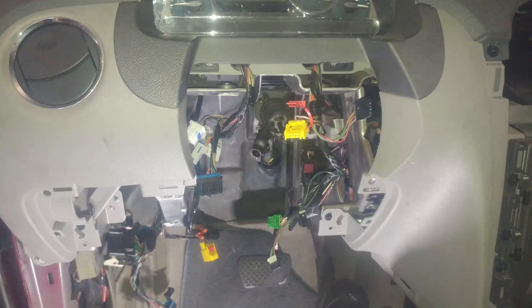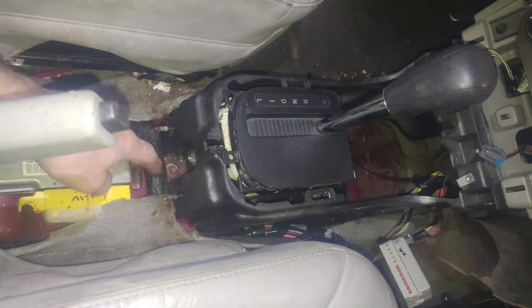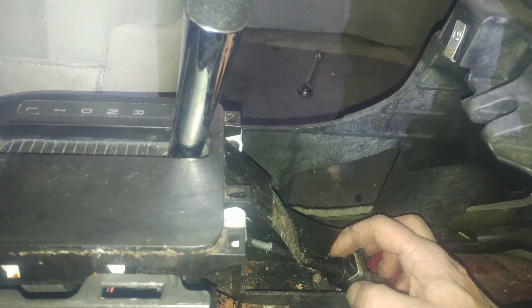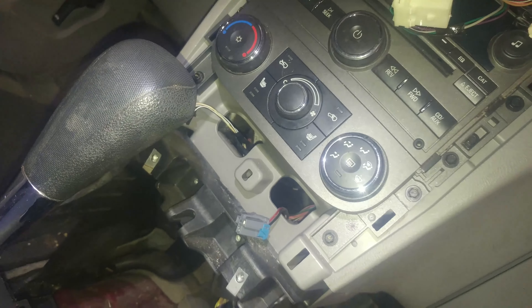So that's where we're at — this is still just an overview video, not a step-by-step. Center console: there's a bunch of stuff here. 10-millimeter bolt down here, disconnect the connector over here, and it might be easiest to disconnect the shift lever here — pull that up and squeeze the terminals. I actually went underneath the vehicle and disconnected it at the transmission, but I think that's kind of a pain. There's a bolt here and on the other side as well, and a couple in the center.